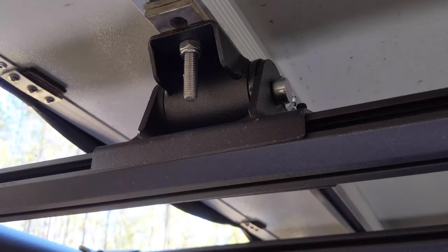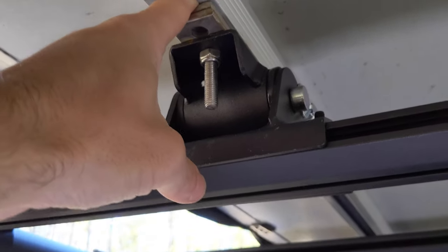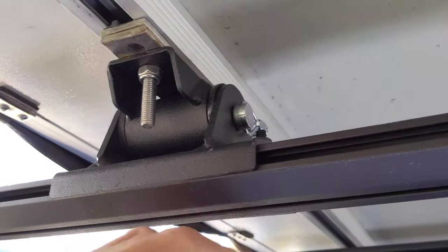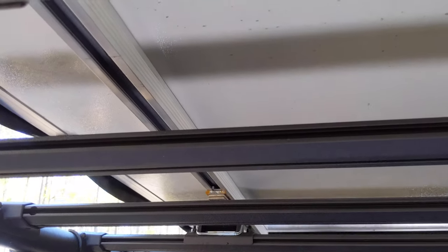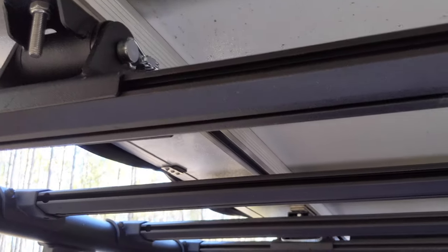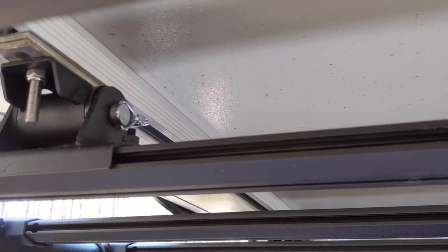It doesn't squeak, like I said. So this is probably not endorsed by CVT at all, but these are the pieces that would normally mount under here and then tie into your crossbar. We use them as spacers down there. And then over there, we added a third piece, you can kind of see it, to get us a full 3 inches of height. If you were to just use the tent mounts on the rack itself, you're only getting about 2.25 to 2.5 inches of height over the rack itself.